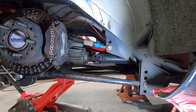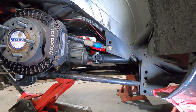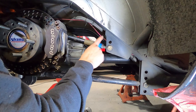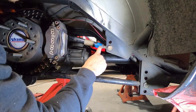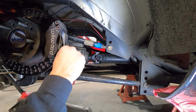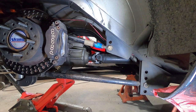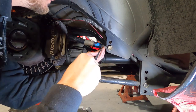Alright guys, I got my tires off. This is the way Tim McCamus says to do this, so I'm trying to familiarize myself with four-links. These are older bars and they don't actually have flats marked on them — usually there's a flat attached to the four-link bar and then you have your jam nut. I don't have that, so I put some marker tape here and marked every flat in accordance with the flat of the jam nut. I'm going to loosen these up and try to take out two flats, counting as I go to find neutral, then go back minus two. I'm not really sure what it's got in it now — I'm learning as I go. If you see something I'm doing wrong, just put it in the comments.